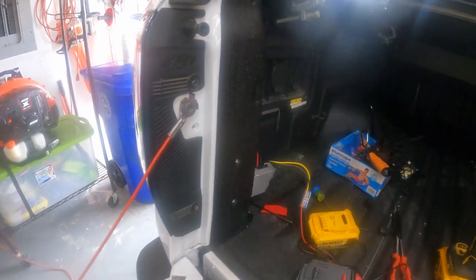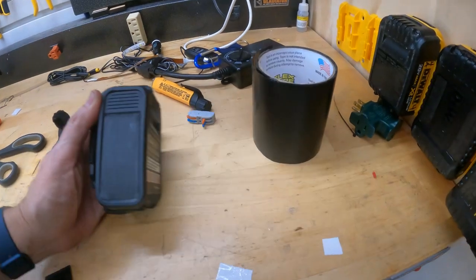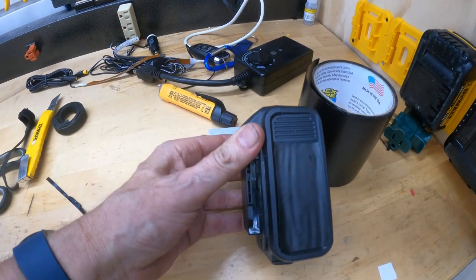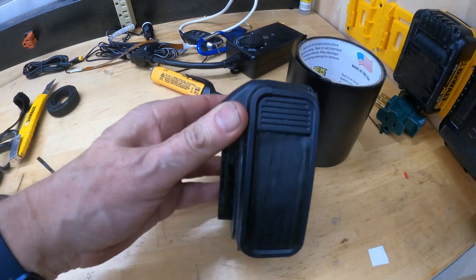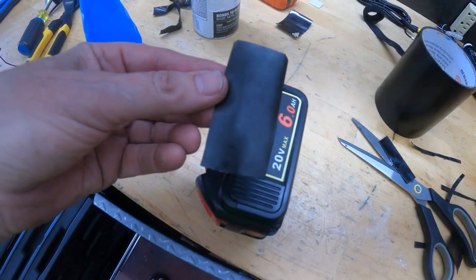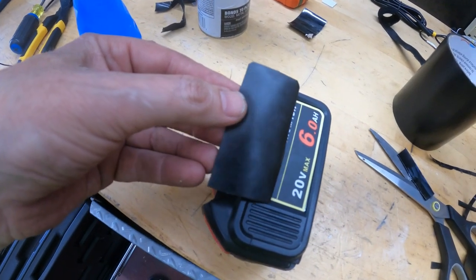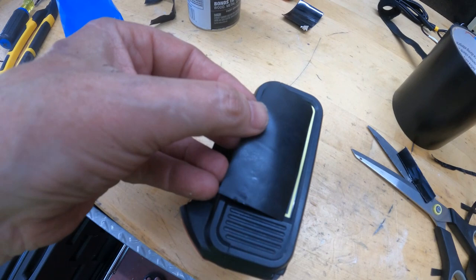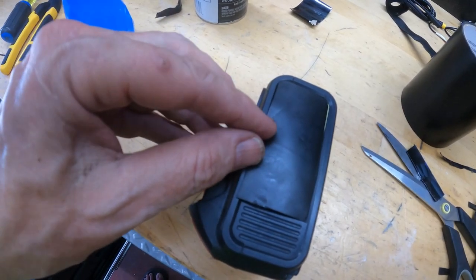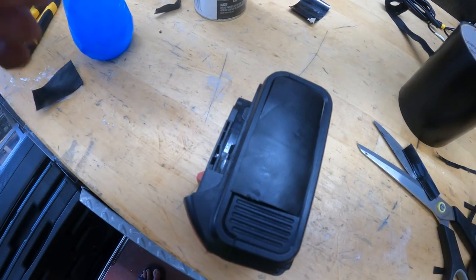When you open up your bed on the driver's side, you can see it's the original locking nuts that came with the kit — this is when I was dry fitting it to see where everything would fit. You can also see how that bright yellow battery supply adapter is going to really stick out. If you don't want that on your vehicle, you can spray paint it black using flat black primer — it's more concealed, and the primer binds a little bit better. I have several DeWalt batteries, probably 15 or 20 of them. I decided to use a generic one that's already black, and I used a piece of black flex seal tape to cover the label. When it's installed, you really don't see any color or labeling — it's pretty much just flat black. And if any water gets in under the tonneau cover, at least I ruined the generic battery instead of a good one.